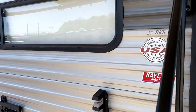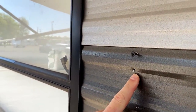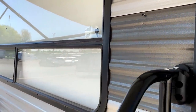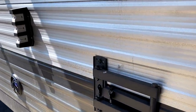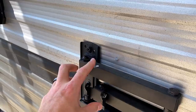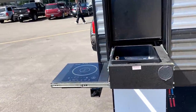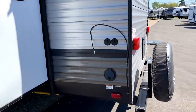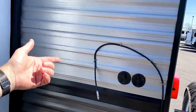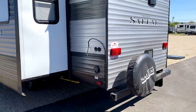I have noticed a couple spots where they used drywall screws through metal siding — generally speaking I don't recommend doing that. We've got a couple holes here and that's a problem. I'm heavily recommending that we have somebody walk around and touch up a couple spots because if you get the right color of sealant it'll be fine, but you obviously don't want to leave it that way. The coax line runs over here where the TV hookups normally would be. This RV doesn't have a standard outdoor entertainment center, so they basically ran their own cable up through here, then down through the underbelly and under the skirt to that junction box on the side.